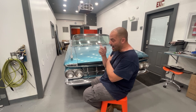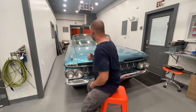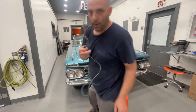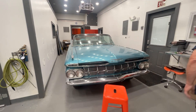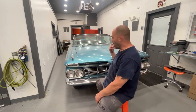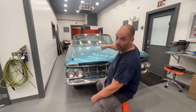I need to figure out the rear brake lights — they're not working. I have power going to the brake light switch but nothing coming out of it. I also found an original plug that'll work for the convertible top, since I don't have that section of the harness that goes to the pump. With that plug I'll run new wires and make a harness that connects to the convertible top switch.